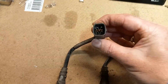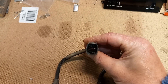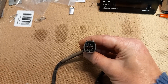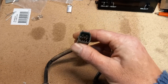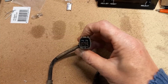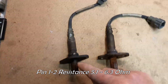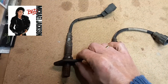You have the connector over here like this, with a little link for the locking mechanism on top. The top two connectors are two pins where you can measure the resistance. The resistance between connector pins one and two should be between 5.1 and 6.3 ohms. And this one checked out bad, so this O2 sensor is bad.